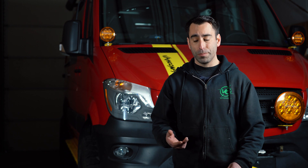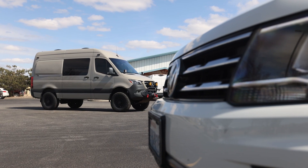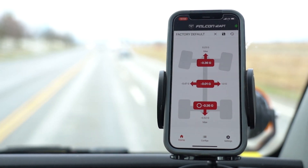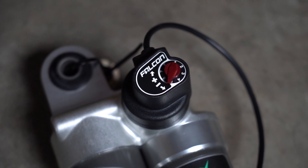The main reason why you want adjustability in your suspension is to compensate for various road conditions and payload capacities. These vans vary as far as what their intended use is — some are used as cargo vans, some as full-blown camper vans, and some are weekend warriors that are a combination of the two. Being able to ramp up your shock damping profile by firming up the suspension is invaluable in making the ride quality as optimum as possible. Additionally, the ability to soften up the shock absorbers for off-road travel really minimizes the harshness you experience on washboards and undulating forest roads.